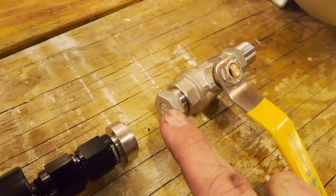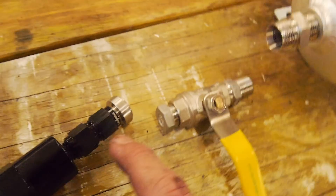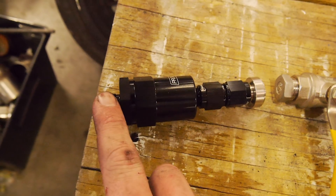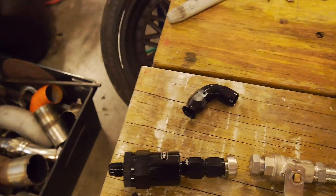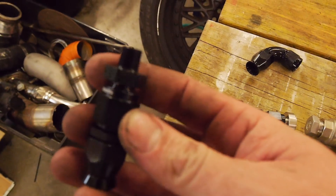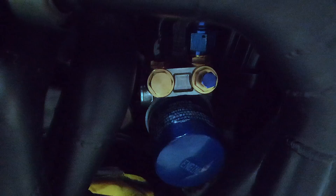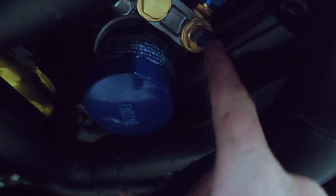I've also got a quarter inch stainless locking bung — I'm going to drill a hole in that and weld a dash six stainless weld fitting onto it. Then there's a dash six female-to-female fitting going through a dash six 40 micron filter, and then a dash six line made up from fuel line I've got left. That goes to an eighth inch NPT straight fitting, which screws into the pre-drilled and tapped eighth inch NPT port on my oil cooler sandwich plate. That will be perfect for priming.